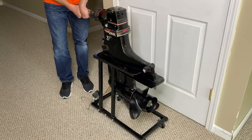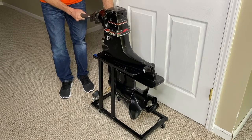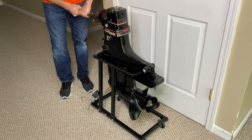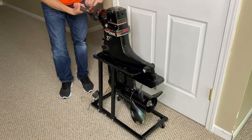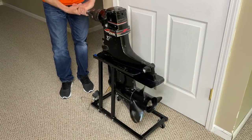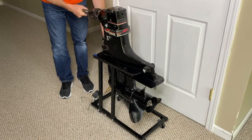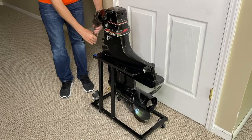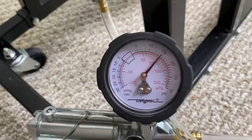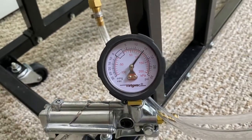You can see the propeller moving and all the internal gears moving with it. Turning it to neutral — if you turn the yoke shaft left or right, the propeller is not moving. We've performed that step. Let's check the PSI — 15 PSI on the dot. That's exactly what we want. We'll see you in an hour and a half.